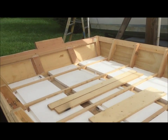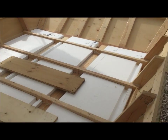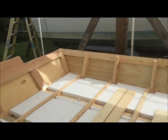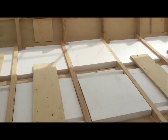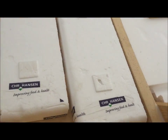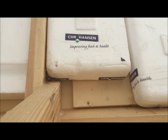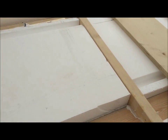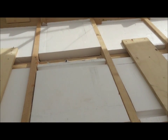Okay, here's where we are at. We have the foam all cut and fit in place. Vacuumed the boat out about three million times - still have little styrofoam balls everywhere, got the best I could. In the center here, as you can see right down there, I have the butt joint backer board which is three quarters of an inch thick. That took the styrofoam up perfectly level with the frame members.